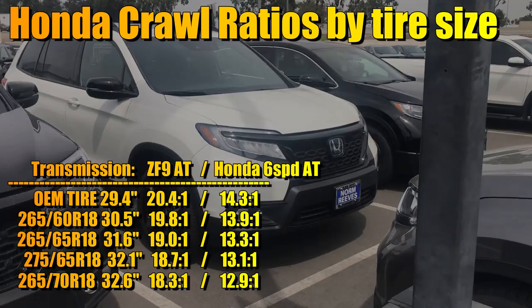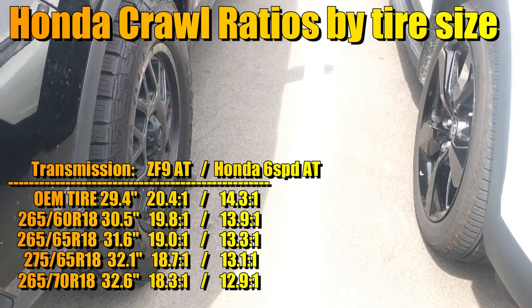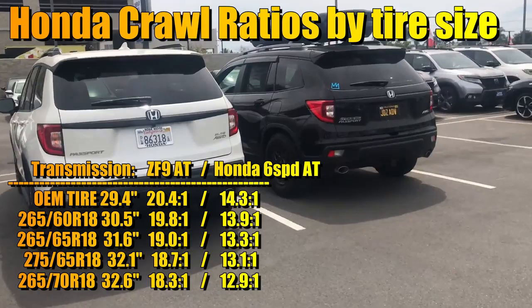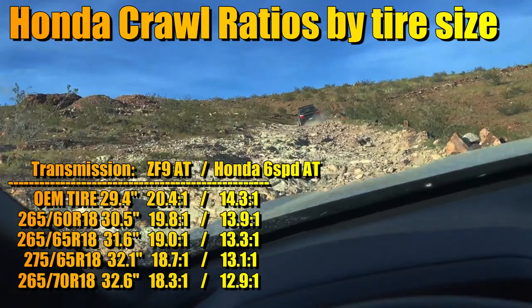I almost forgot to mention that increasing your tire size is going to decrease your crawl ratio. And if you watch my channel, John DZ Adventuring, you should be familiar with that term, crawl ratio. I use it a lot. Take a look at this chart and familiarize yourself with how taller tires will affect your Honda light truck. There's two different transmissions. The lower trim Honda Pilots have the Honda 6-speed, so does the Ridgeline from 2017 to 19. The upper trim Honda Pilots and the Honda Passport and the 2020 Honda Ridgeline have the ZF 9-speed.